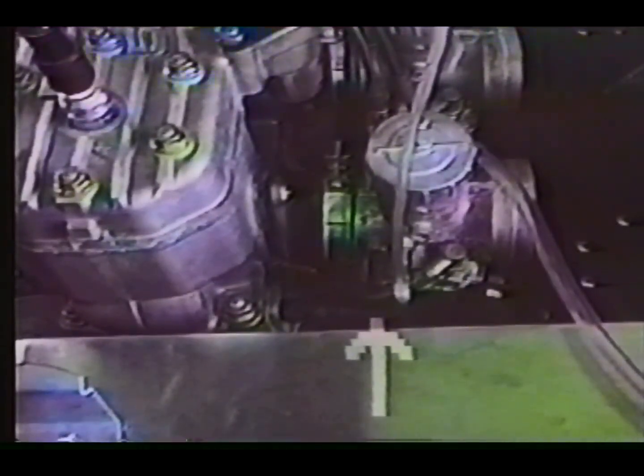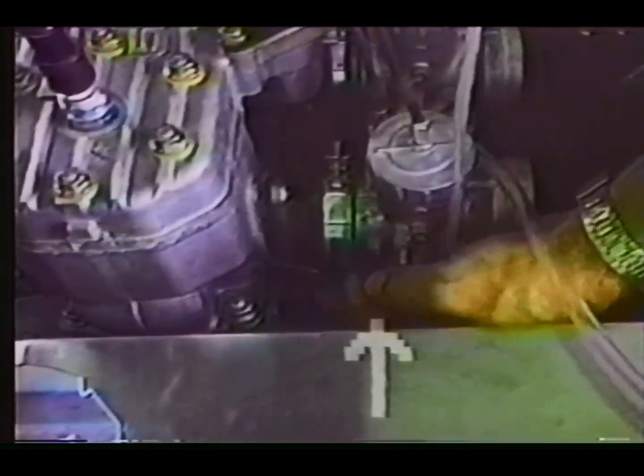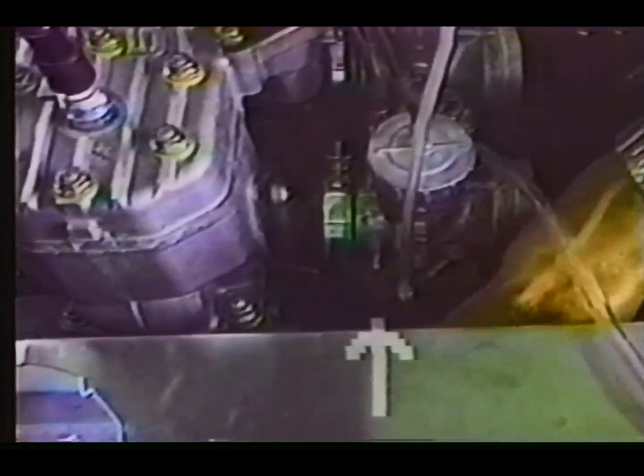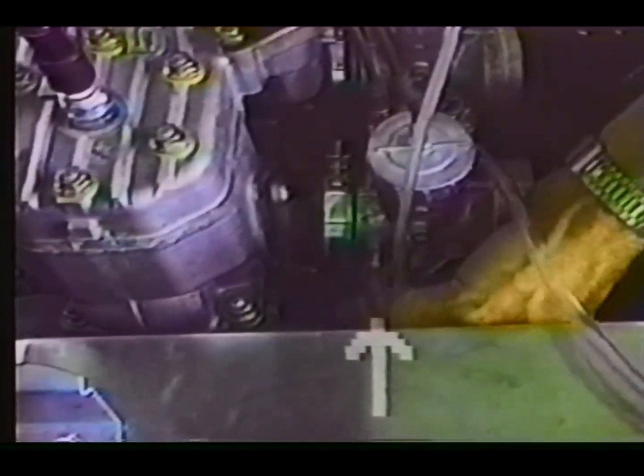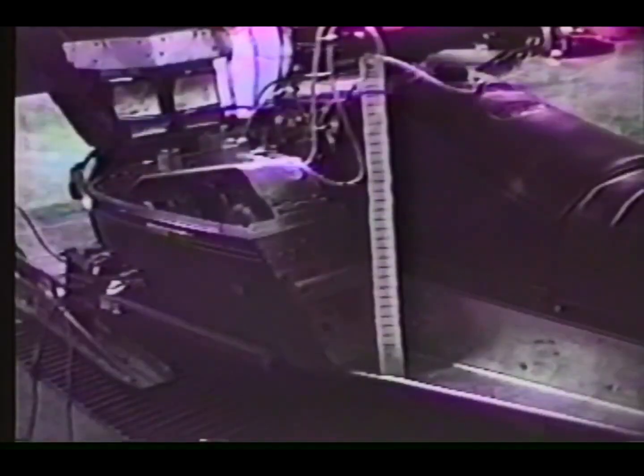On engines equipped with 38 millimeter carburetors, vacuum fittings are provided for use of mercury manometers or vacuum gauges. In order to synchronize carburetors, we will be using the mercury manometers here. Machine preparation will remain the same as with the Unisync gauge. Follow the instructions in the service manual to prepare the machine. Remove the vacuum fitting rubber caps from each carburetor and install the mercury lines. Try to keep the board upright at all times to avoid mercury spillage or ingestion into the engine.